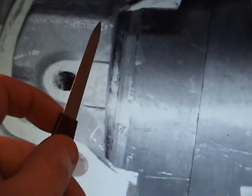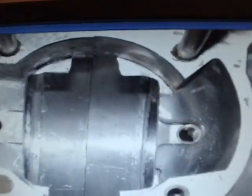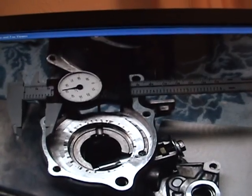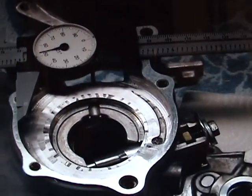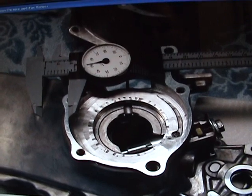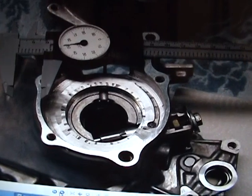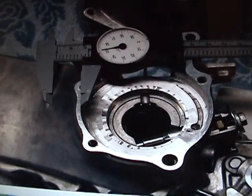Now I have to worry about this side. This back area has been cut out — 52 millimeters, 52.5. The bearing races have been cut down a millimeter and a half, and now I have to go up and do this side too. You see how much effort it takes — it's fun to do, it really is. You want to have a set of calipers with you; the calipers can tell you how deep you need to go and what you need to take off. Especially if you don't have a machinist handy to ask questions, because there is no one I ride with who knows anything about this. A local Honda shop will tell you this doesn't even exist.